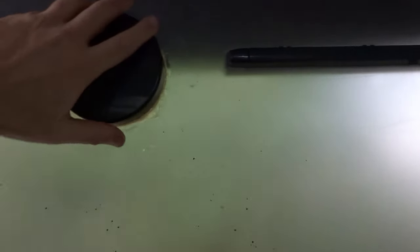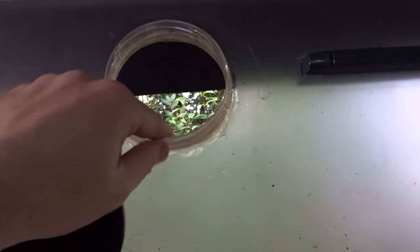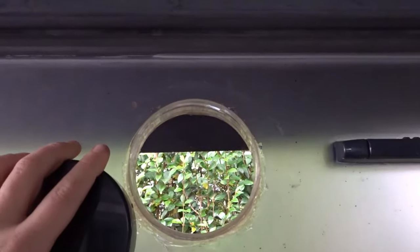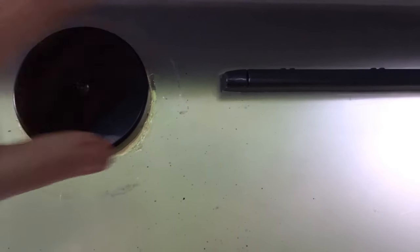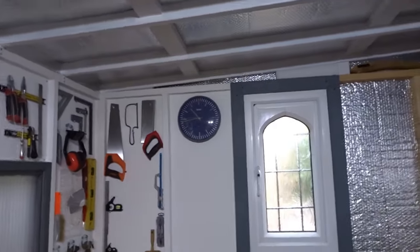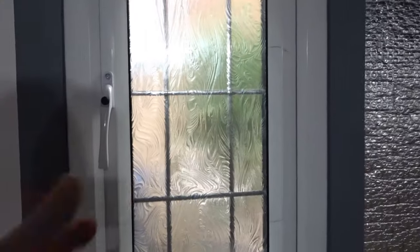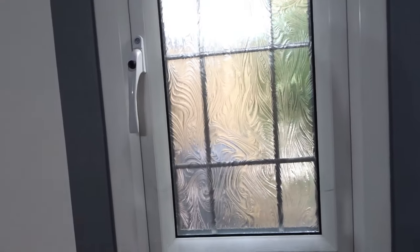The trickle vent is a large one you can buy very cheaply — I think this was three or four pounds — designed for double-glazed windows. I've added it into this window and leave it open so hot air can trickle out. I've also made another vent using the lid and neck of a sweet jar, glued in with epoxy — a slightly bigger vent. You want these vents to keep everything dry, because what seems like a condensation or damp problem is often just heat from your breath condensing because it can't escape. Always have a vent and an openable window.